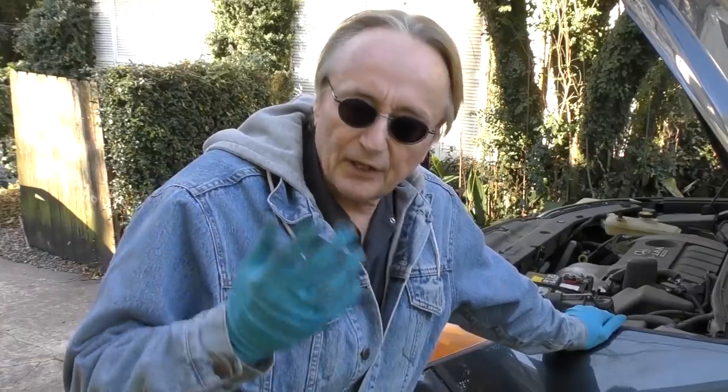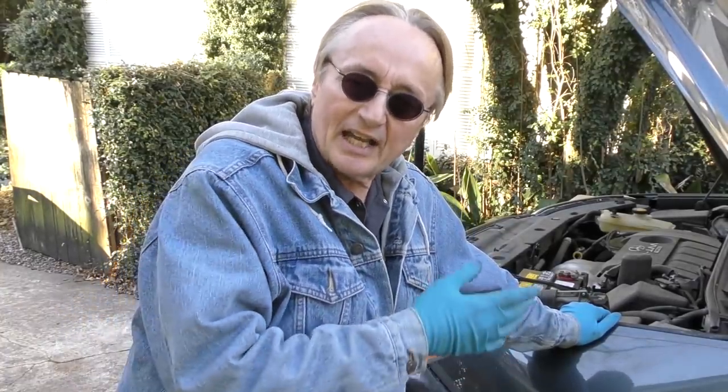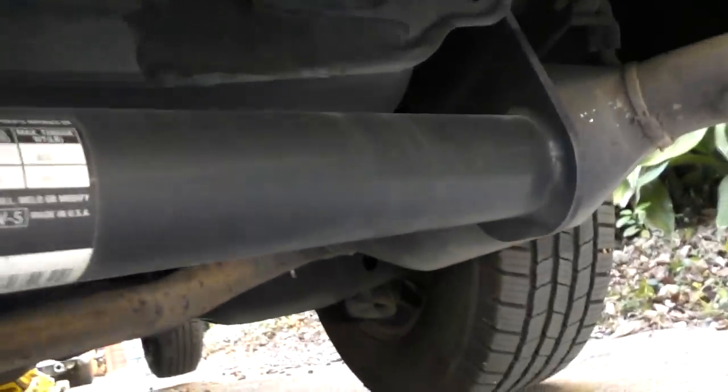losing control. So if you feel you're losing control when you're braking, first, of course, check the brake system. You gotta start logically. The brake fluid is full, and when I look under the vehicle and check all the wheels, the front, and walk around and check the back ones inside and out, I don't see any leaks. Well, I figured it probably isn't leaking because the brake fluid's full, but you never know, it could be starting to leak. But they're bone dry, so they're not leaking, and I pull off the right front wheel to see what the brake pads look like.